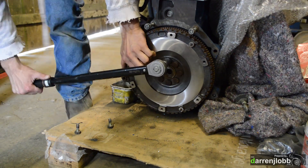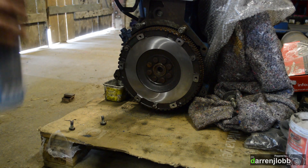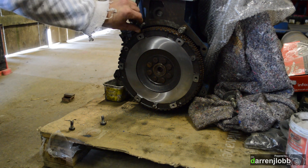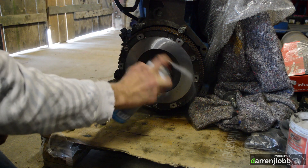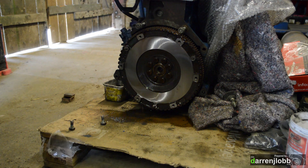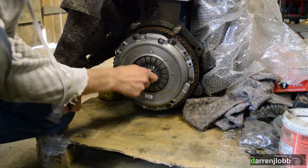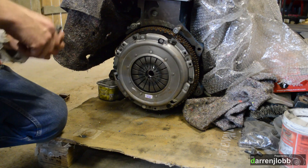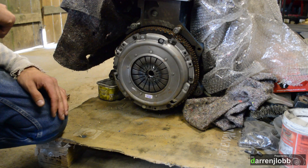Get the torque wrench out and just whip around these bolts and bring them all up to torque. Another thing to bear in mind when fitting a new clutch - you want to clean the face of the flywheel and the face of the pressure plate with brake cleaner. You'll very often find particularly the pressure plate in a clutch kit will have some kind of oil or grease on the surface to stop it going rusty. You don't really want to leave that on there - it's not going to help the clutch bed in and can cause the clutch to just glaze up. Go in with some brake cleaner and clean it off. The flywheel has also got a coating on it to stop it going rusty, but you want to do the pressure plate as well so you've got two nice clean metal surfaces for the clutch to bed in on. The clutch is on now - just used an old input shaft for the alignment tool like normal. Bolted them all up, torqued them all up, and that should be ready to slide the transmission onto the side of the engine.